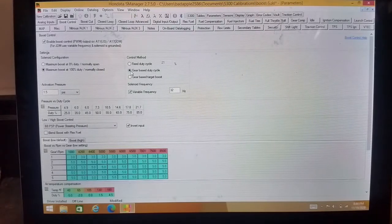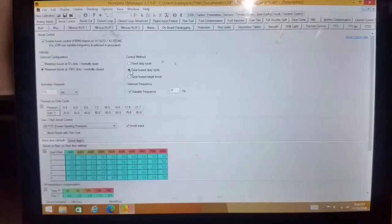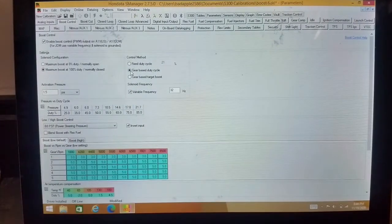Well, there's going to be a threshold where you get to a certain point and it's going to jump. So don't just creep up on it. Don't just go from 40% duty cycle to 60. Because if the threshold was like 45 and you just went to 60, you're sending it to the moon. Because mine, literally, 40% duty cycle makes 20 psi, 50% makes 30 plus, 31 I think, which is the difference of like 500 or 600 horsepower to almost 800. So that's an incredibly big difference.